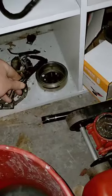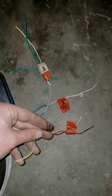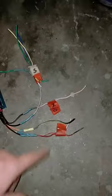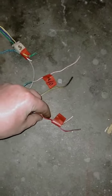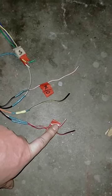When you turn the scooter off, you want to disconnect this from this — disconnect the stator from everything. The stator is not live unless it is spinning, but the battery is live whether it is spinning or not. You want to connect the kill switch from the stator side, not the battery side. This won't be connected unless the stator is spinning, so you can connect that to earth — as long as it is also disconnected from the power, which is what happens when you turn off the key. If you wire it up like that, you can't go wrong.